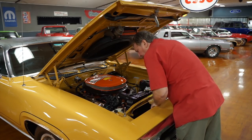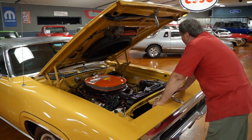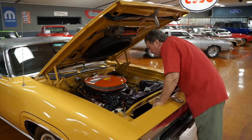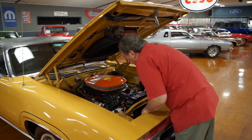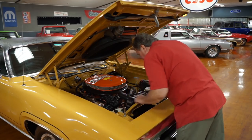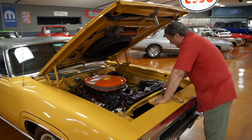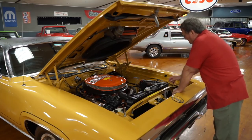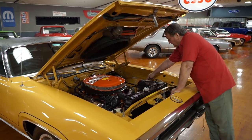You can see the plastic vent grates are still intact and just as clean and nice as you'd ever want. It has dual horns on it. There is absolutely nothing on the front of this car that has been disrupted — absolutely nothing. New battery in it. New dual-stage master cylinder also. Presto-Lite distributor with high-silicone plug wires installed, but it is the correct Presto-Lite distributor that belongs with this car. Correct washer bottle for 1971. The radiator core support has the serial number of the car on it — so it's never been disrupted, never been wrecked, no trouble whatsoever to the front end. This number coincides with the VIN plate on the top of the dash and the fender tag installed on the fender well.